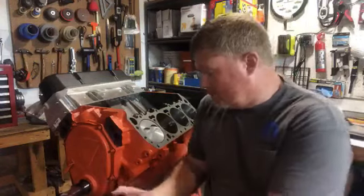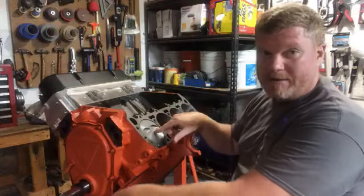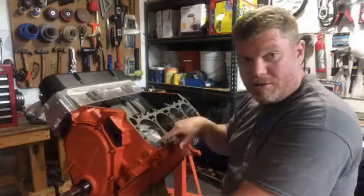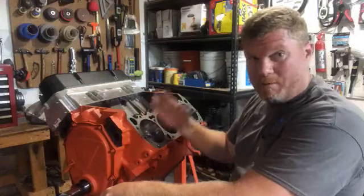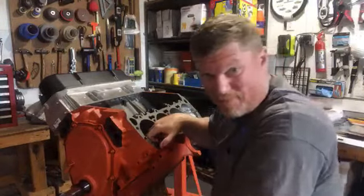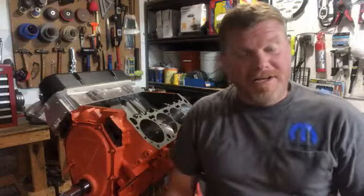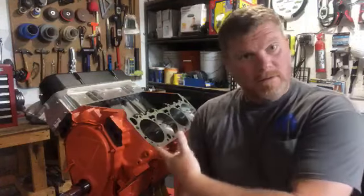let's pretend this is the exhaust cycle. Well, it doesn't matter. This is the exhaust cycle, all right? The exhaust is being pushed out, and now it's starting to drop back into the cylinder. And when that does, the intake valve is open, and this is causing vacuum and sucking in fresh gas and fresh air, okay? That's naturally aspirated. Naturally aspirated means, like the diaphragm in your lungs, you're inhaling, you're causing vacuum, you're sucking in air and fuel on that stroke.